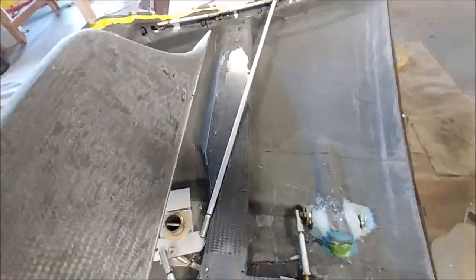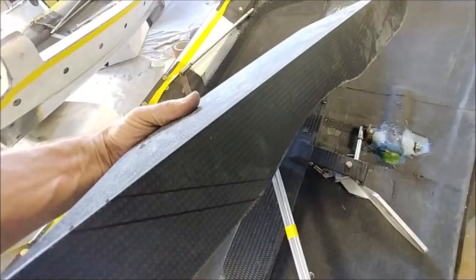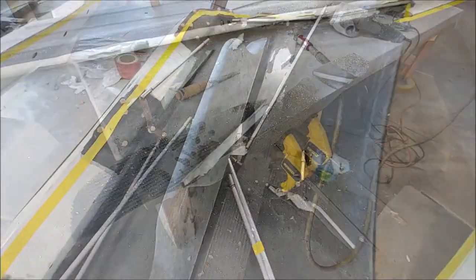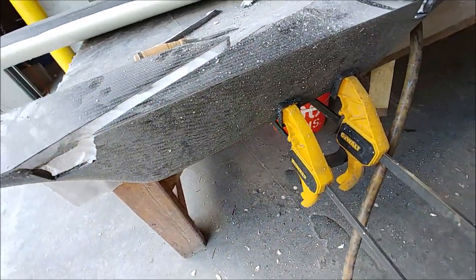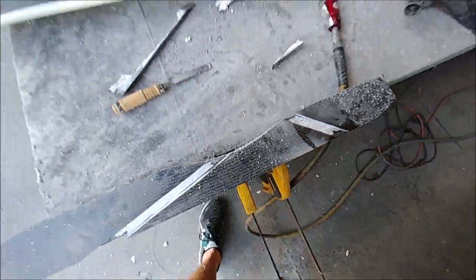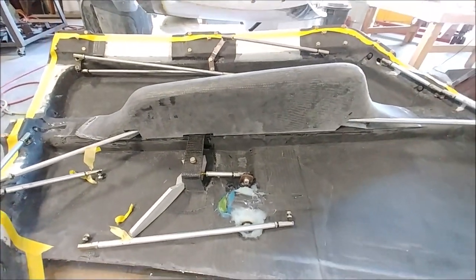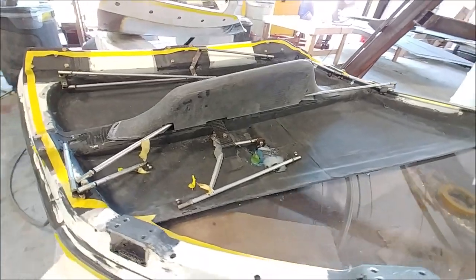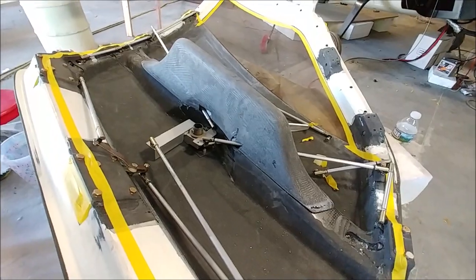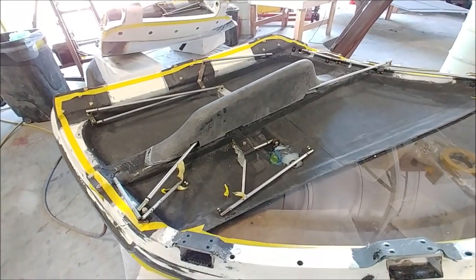Next thing on the doors — these armrests needed a sort of mouse-hole cut around where the linkages go. You can see I've marked out where the cuts need to be. I got out the Dremel saw again, clamped these to a table, and just cut those notches out. That's what it looks like sitting there — those are the ones that were laid up around some foam. I also had to fair out a little in the middle where the lock is, and I'm going to drill anchor holes in either end and put in some nutserts into the door frames to bolt that up.